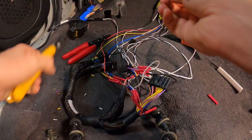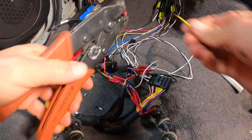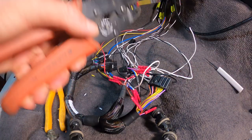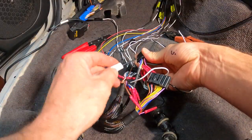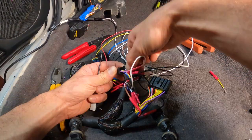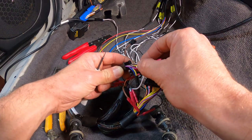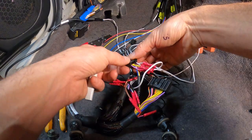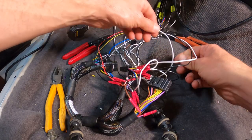Pin going down here, boys. Flex fuel sensor signal back. So we just make our little jumper lead here out of the back of this. We unlock our plug on the back here. There's a little tab on the back of this one that needs to be just slightly pushed down so it unlocks. I know that this goes into number 7, which is that one there. There we go. We clip that. Let's clip back in now. They are locked in. Flex fuel signal.